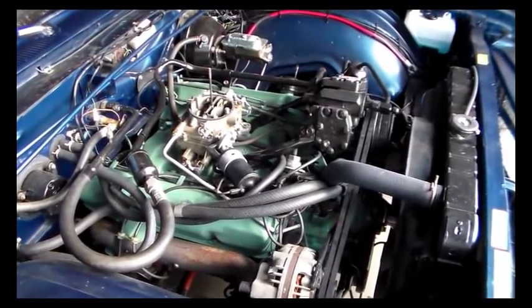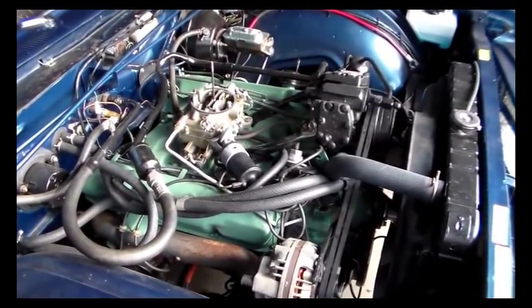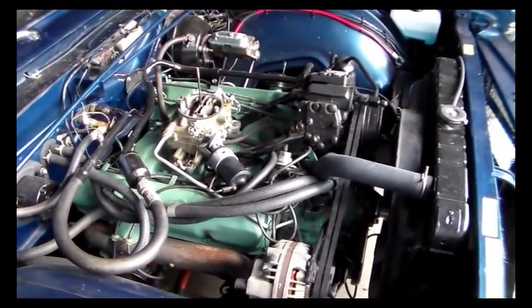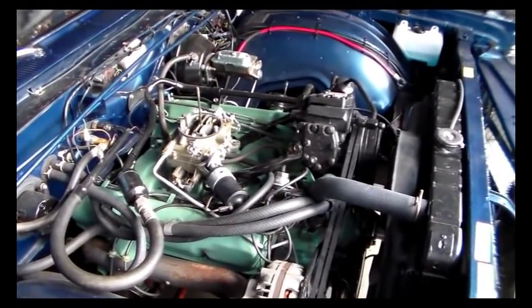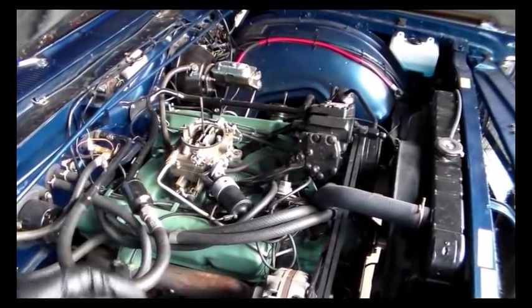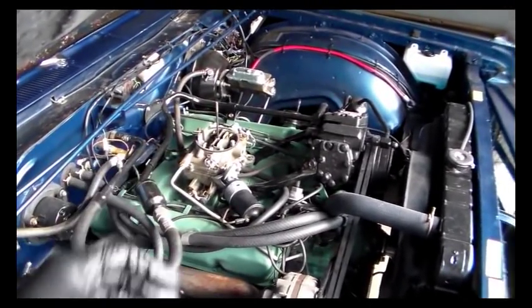And one of the issues that I ran into with this car was that the carburetor tends to flood after I shut it down when it's hot. Well, it's very warm to hot. It's operating temperature and it heat soaks for a while. Evidently the carburetor is getting hot and it's something that's going on with the fuel in there. It's boiling, it's bubbling, it's forcing it out where it's not supposed to come out at.